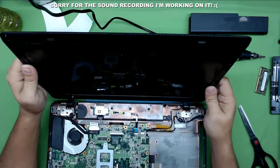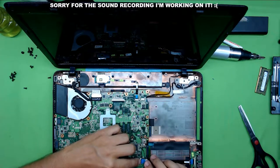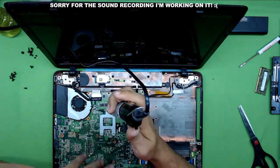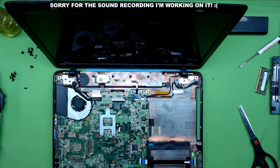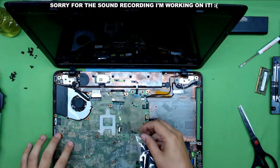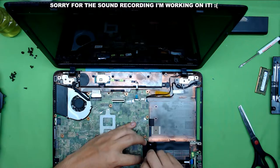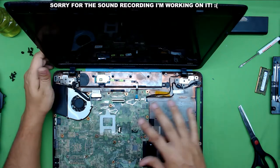Unplug it. There's no hard drive, so you can turn it on and off as much as you want as long as the hard drive isn't plugged in. Continue by plugging the ribbon cable for the USB hub. Put in the screw for the board right on top. Make sure you put the plastic cover on top, otherwise you might short the board. Make sure you run this cable over the correct path — unplug it, reroute it over. Nothing bad happens if it goes under, it just shows up under the hard drive.